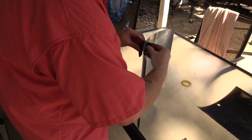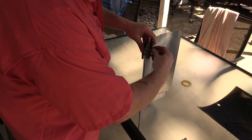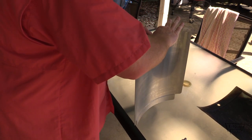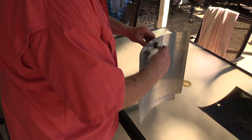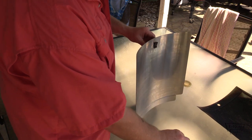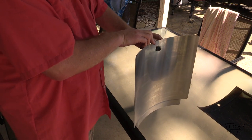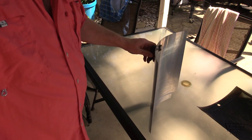And then once it gets pretty tight, you can wiggle the inside piece and the handle. Make sure the square lines up, because that again is how it locks in place. Rotate the handle, rotate this piece here, make sure everything is tight and that square lines up. You can get your ratchet, turn it the right way, give it just a little, maybe a third of a turn. You don't need to over tighten it and strip it out. So when you turn this now, this is turning. Really simple. Let me show you it installed on the Weber Smokey Mountain.